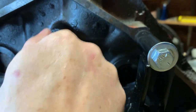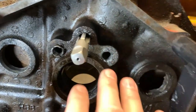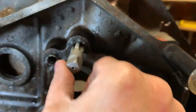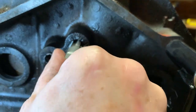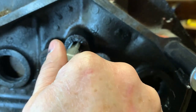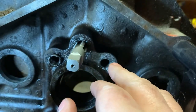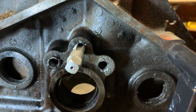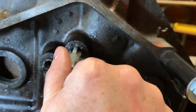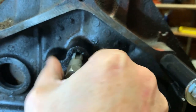and then using a tap to recut the threads. So I was trying to avoid recutting the threads completely. So what I did was, even though the plugs were still in the hole, I used the tap to remove some of the plug material and get to where I was actually touching a couple of threads. And then I just kept working the tap back and forth, removing more of the plug a little bit at a time until I was able to fully engage all the original threads. And then that seemed to work.